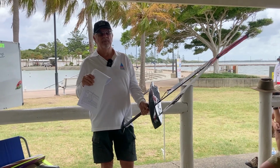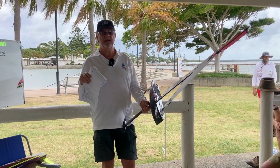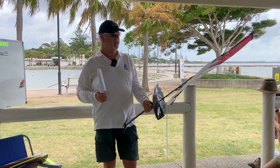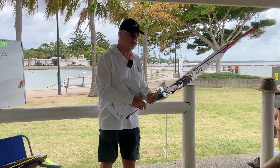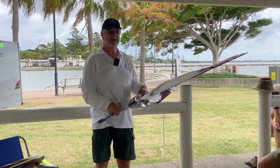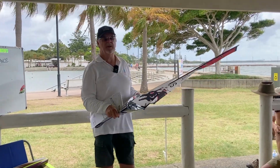I like to do it to boats which are new. And it's a preventative maintenance. It's a reinforcement. It works. Older boats, it's not. You can't guarantee it, because the older boats have normally had a bit of residue in them, a bit of salt, a bit of lubricant and things like that floating around the bilge. Gets into the pores of the plastic. It's hard to get out. Hard to get a good key when you're putting a fiberglass patch on the inside.